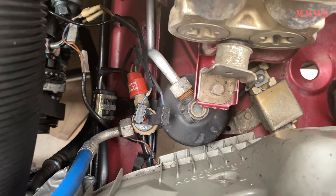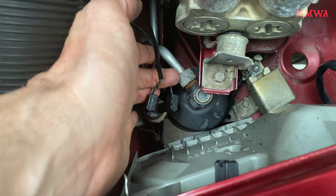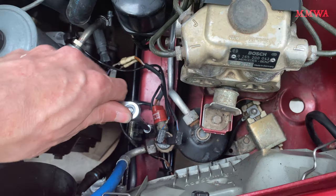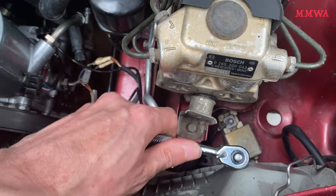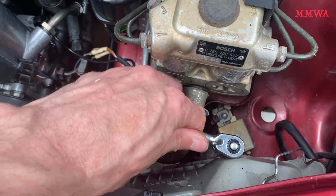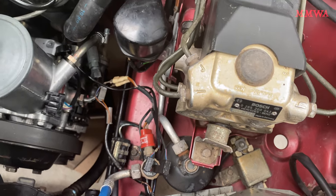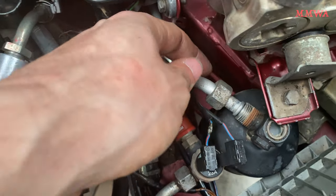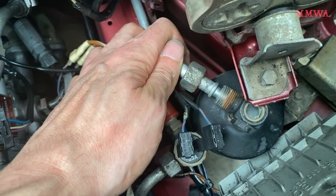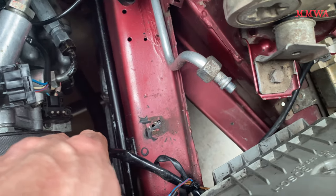Next it was time to move on to the receiver dryer, which must be replaced when fitting a new compressor — otherwise you're putting your new compressor at great risk. There is some botched wiring here that I will attend to later. The receiver dryer is pretty straightforward to remove — it's two bolts either side, and obviously the hose connections need to be disconnected. I don't ever reuse the two switches on these receiver dryers; I just put new ones on. One is a high pressure switch that turns on the auxiliary cooling fans at half speed — that's the red one. The flat disc-shaped one with the botched wiring is the one that cuts out the compressor when there's no gas in the system.